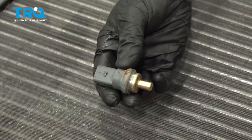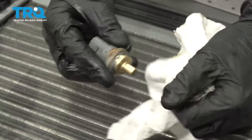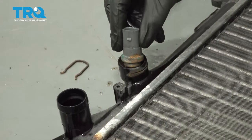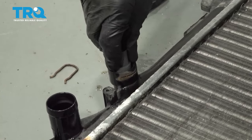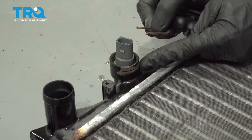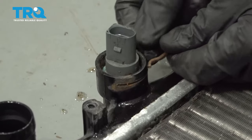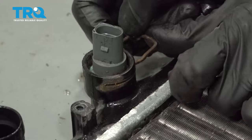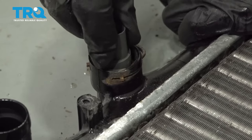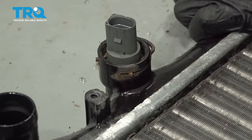Let's get ready to install our coolant temp sensor into the radiator. Of course, if you're reusing your coolant temp sensor, you wanna go ahead and wipe it down and make sure you don't see any dirt or debris along this area. Let's go ahead and put it in place inside the radiator, press it in, give it a little twist, and make sure it feels like it's secured. Continue on with your locking clip. Looking along the sides, you can see there's a groove that each one of these ears needs to fit into - one here, one on the other side. Go ahead and line that up - it's gonna slide right directly over the top of the coolant temp sensor, essentially holding it into the radiator. Once it feels as though it's in there, grab that coolant temp sensor and give it a wiggle. Make sure it doesn't wanna slide up and out. If it can wiggle up and down, you're gonna have a leak.